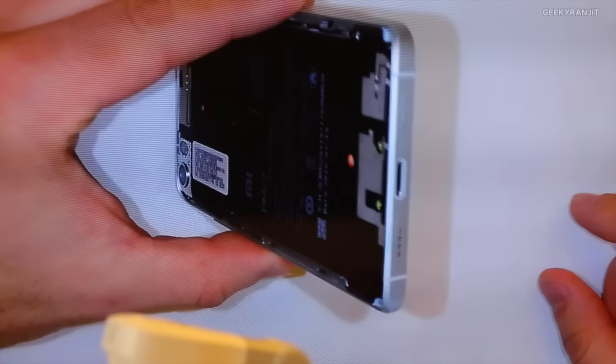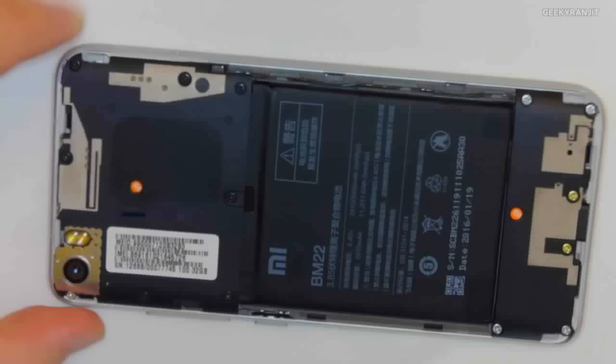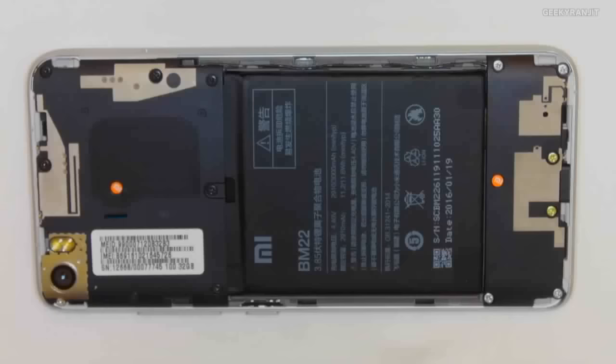So you see here the same thing on the bottom. But this is done for symmetry. We only really need one of the cuts to be active. So what you have is a combination, so diversity antenna that combines this LDS structure here, right, which is this internal antenna, with the metallic frame of the device to basically help with reception.